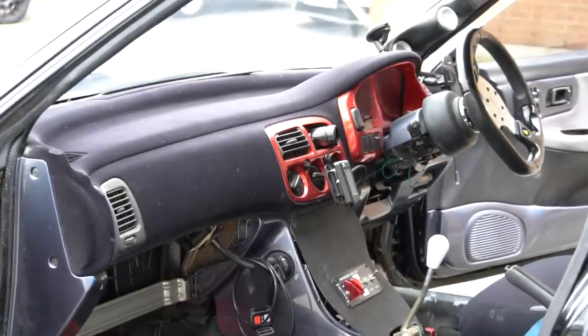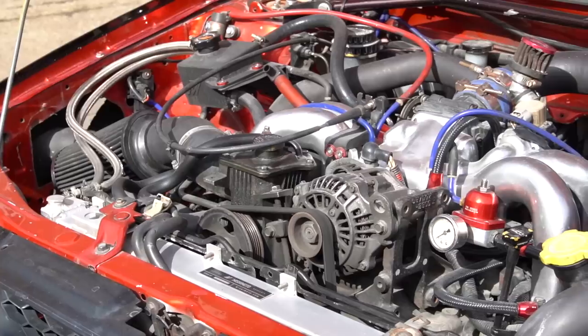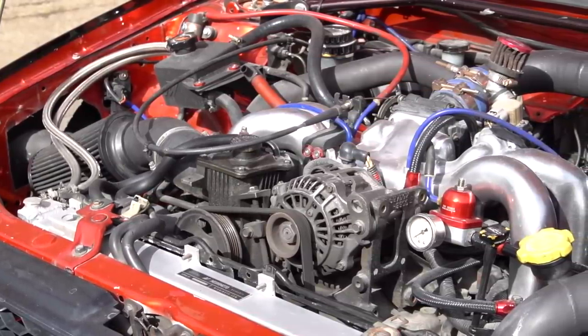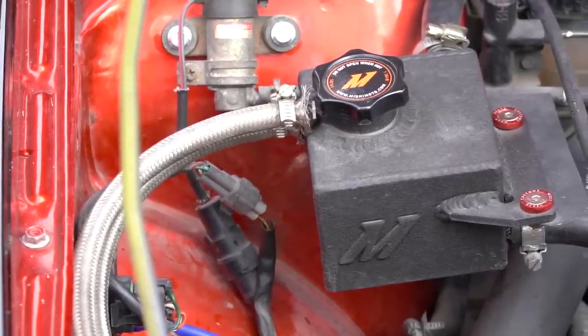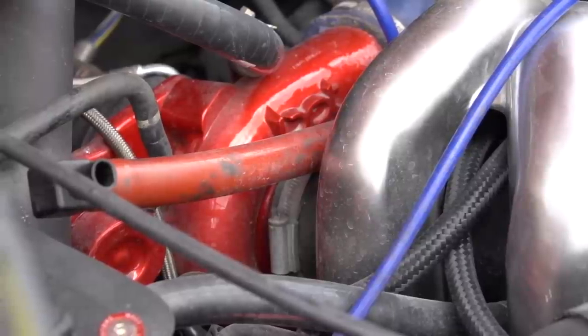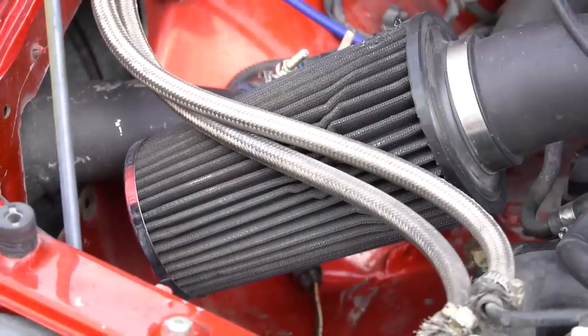This one's running near on 500 brake. Just under 500. What does it take to get one of these to 500? What have you done to the engine? You take the original one out and throw it away, put a new one in. It's got a stronger bottom end, better flowing cylinder heads, and then the rest you just upgrade as you go along. What turbo are you running? It's called a Blouch Dominator — it's an American turbo, commonly known as an SC46 in this country. It's a pretty big boy.